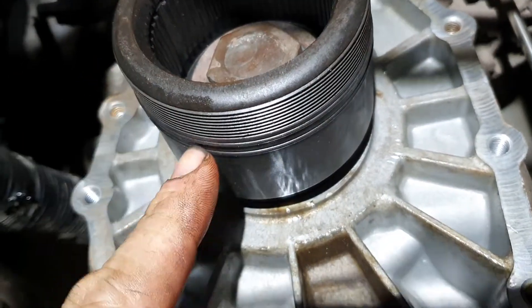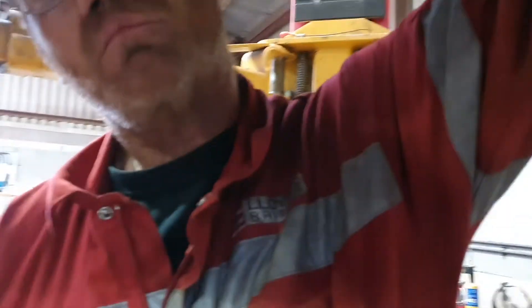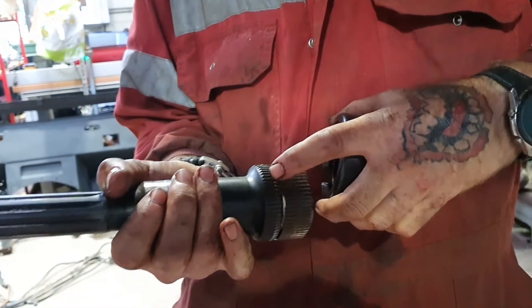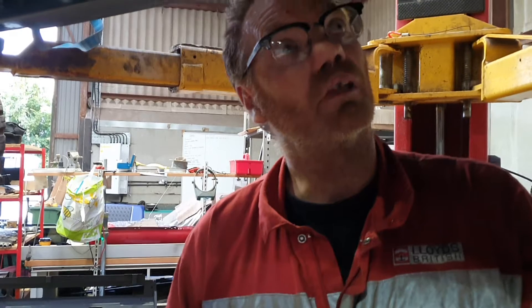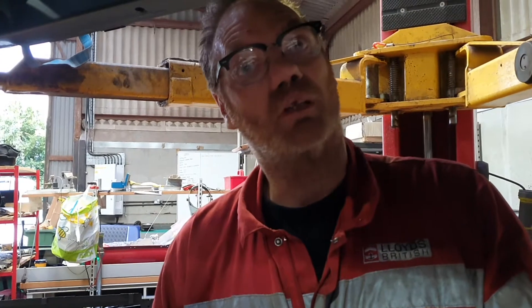It's also fitted with O-rings to prevent oil from escaping afterwards. Pulling the old one out wasn't that hard — the main challenge was getting the circlip off first, as it's retained by a spring clip inside a groove. It needed the help of a slide hammer, and once we had that it came out quite quickly. In reality, if we'd started with that it wouldn't have been that big a job. It's been the best part of a day, which matches what the videos we'd watched suggested. We were also held up waiting for a part for about an hour.